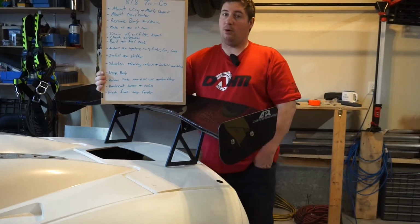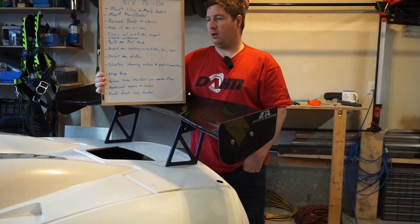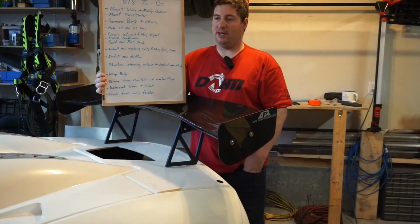Because I did run it at low oil pressure, what I'll do is, right now the system is sealed, so before I take off the oil lines, I'll warm it up, do a compression test, and see where we're at. We've got numbers from the beginning of last year, and I'll see if I've lost anything. I know a rebuild's in my future.